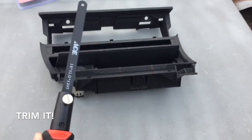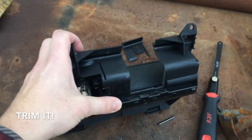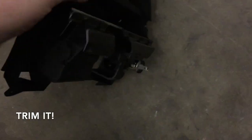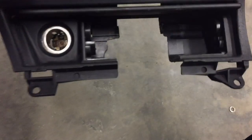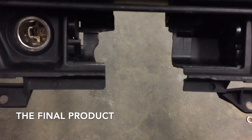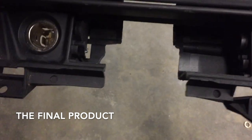I'm doing this the old-fashioned way, just using a handheld hacksaw. When you cut it out, you're going to find that you need to open it up on the inside in order to install it. Your first cuts will have clearance but you won't be able to put the console in all the way to the mount. As you trim, you'll most likely end up with something like this. You don't need as much space to have it in there, but to install it with the shifter you're going to have to do a lot more cutting and trimming.